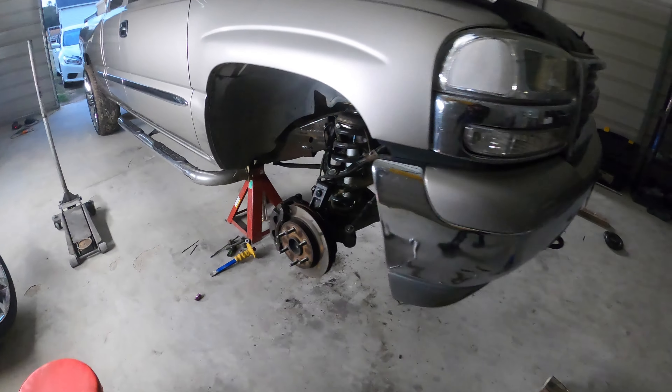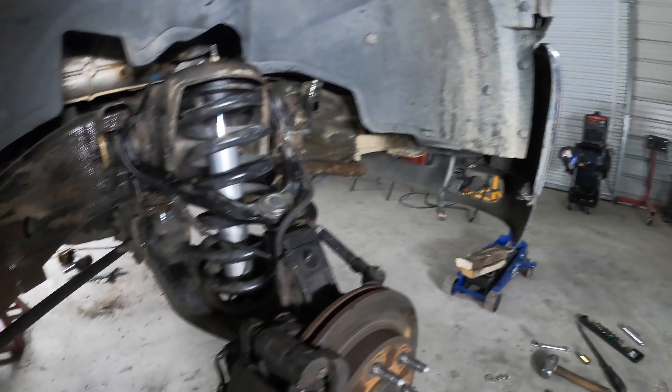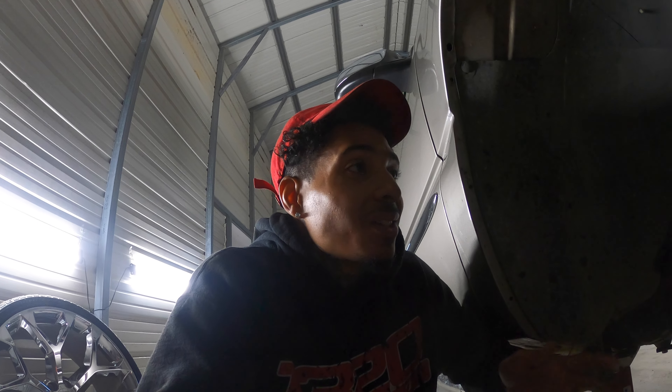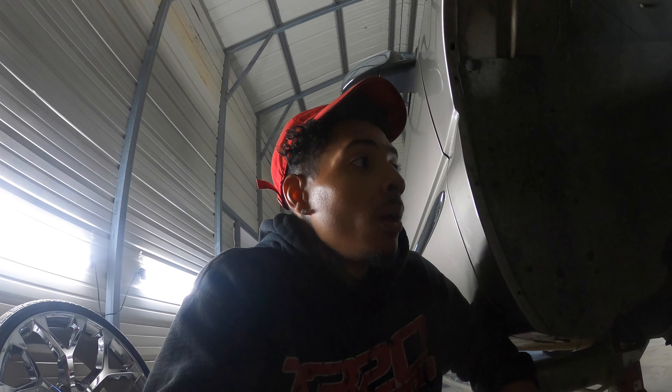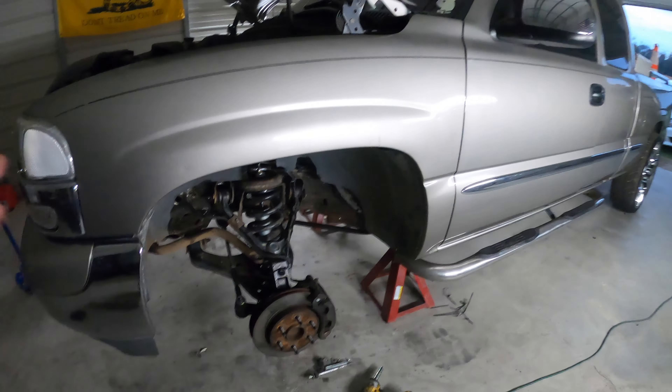Alright, got it all complete, just got to put these sway bar links in. Everything is pretty maxed out, I ain't even gonna lie to you. So if you plan on doing this, it's gonna be a headache from hell, but it'll work. The upper angle isn't the best — it's kind of slanted. So if you end up doing this, I definitely recommend upper control arms if you do anything with your suspension past like a 3 inch level on stock suspension. Extended or upgraded upper control arms help out the angles a whole lot. My best advice: if you got a 2 wheel drive truck with springs, either get a lift kit or lower it, because stacking leveling kits is pretty sketchy.